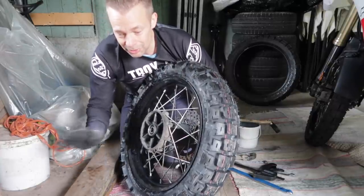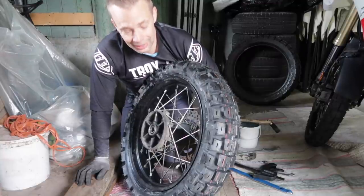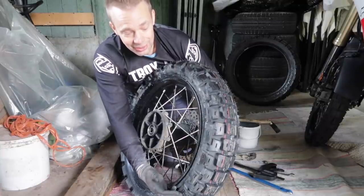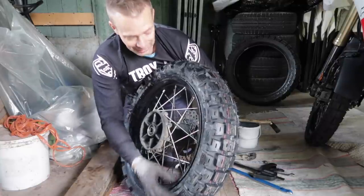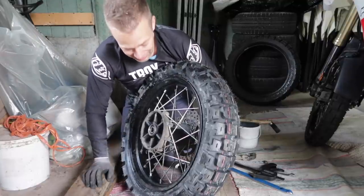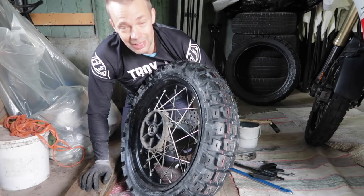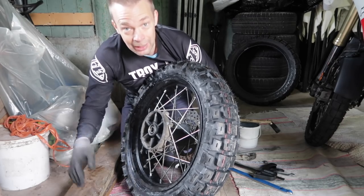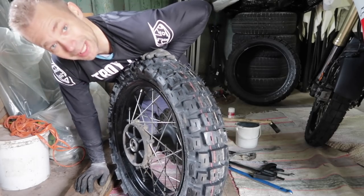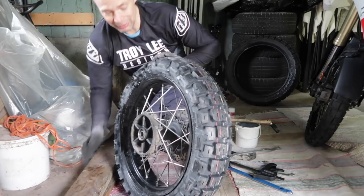It was not a problem at all. Everything was intact. But of course, you inflate the inner tube, and there's a lot of air that needs to seep out through the untight rim. The air needs to escape somewhere, so it sounds like a flat for quite a while. So don't be scared. You need to wait longer to see if you have a pinch flat.